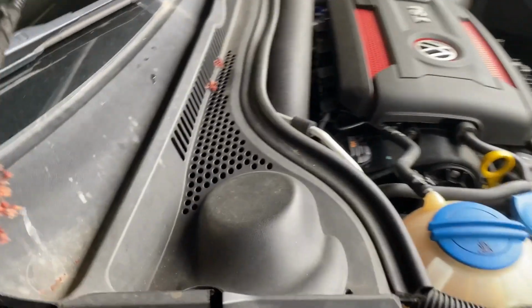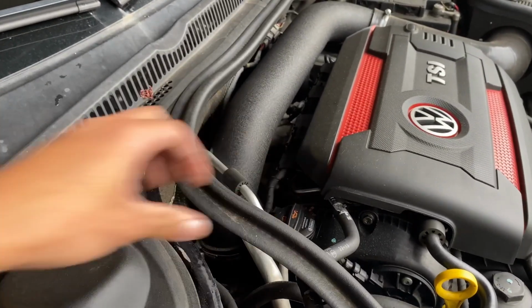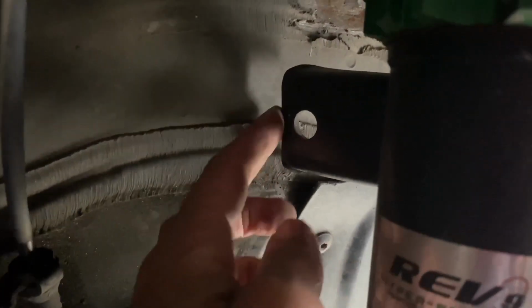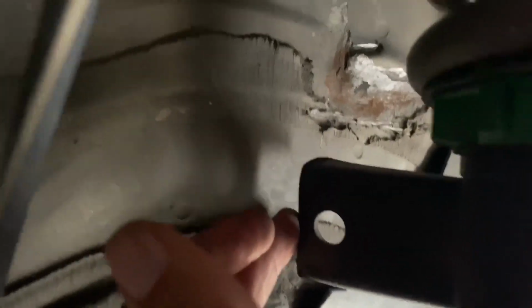So yeah, these do have camber adjustments with the top hats, just like the BC Racing coilovers. As you see there, it's not maxed out. I may add a little bit more camber in today, or I may wait till I get some different wheels. Because if you guys look here where the sway bar and link is supposed to go, there's only but so much room. I would need to clearance it. As you see, it has been rubbing a little bit. So yeah, I may add a little bit more. I don't know, we'll see.